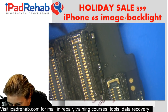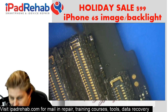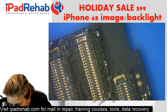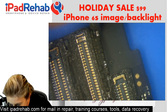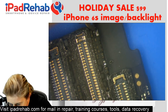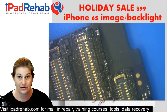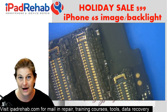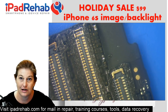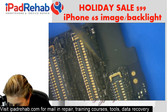A lot of times the image filter gets blown on iPhone 6s, but that's not the case here. So we're going to check for the third most common problem — one of our image power lines that tends to go bad, the 5V7 line. I put a probe on ground and check for a short to ground on that 5V7 image power line using this little cap on the end. We have ground on one side, and the other side — diode mode says zero, zero, zero. We have a signature failure on the image power line: short to ground.